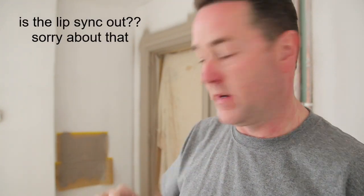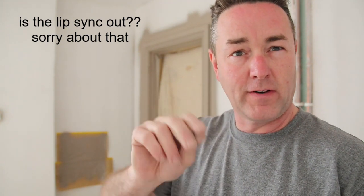Just a bit of an update, everybody. Did the first coat. I used the 110 tip, which sprayed fine. I thinned the paint just enough and it went on nice and wet. Got a little bit of a pimple in it, which is nice because it means it's sprayed, it'll flow out lovely. I've got the blower heater on to warm the air. Now I found that warming the air, because it's a small room, was also warming the paint. Now warming the paint thins the paint.